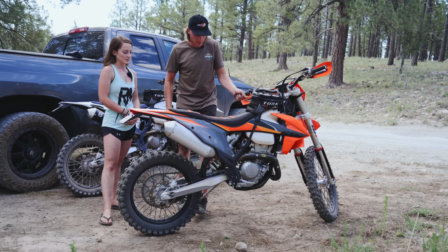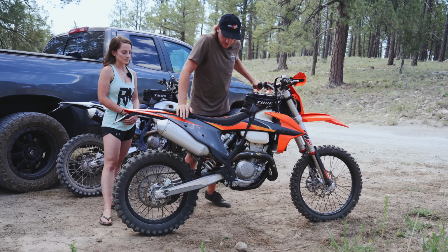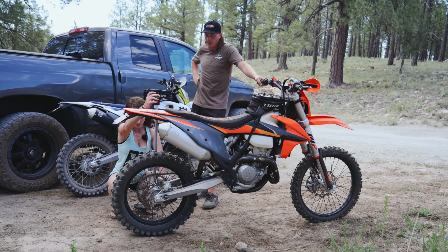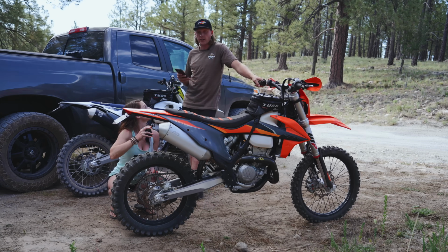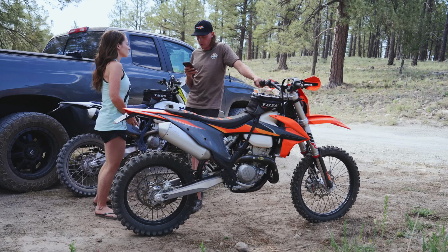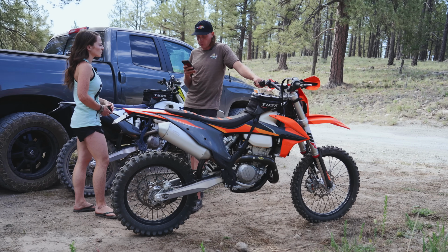Yeah. Let's do it. So now we're gonna go ahead and check the static sag of the old pumpkin. So what are we at, boss? And do you have that same line? I do. So she got 23 7/8. We're gonna multiply that by 25.4. And so we got 606.425.